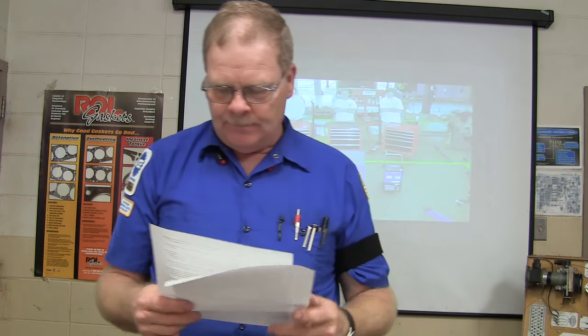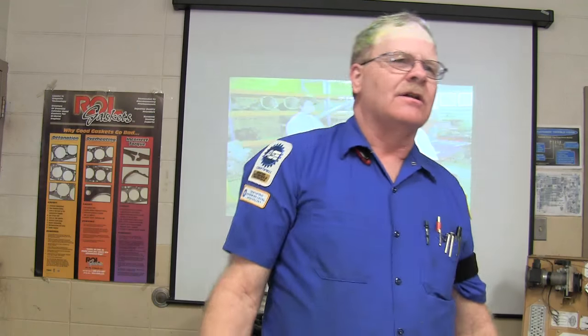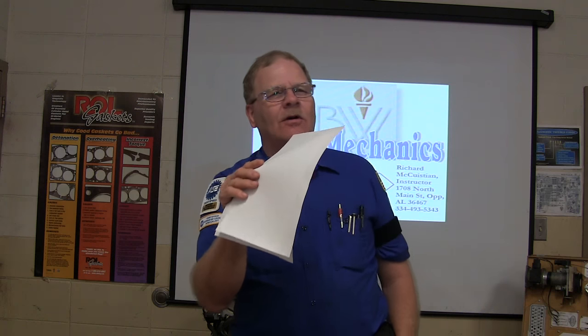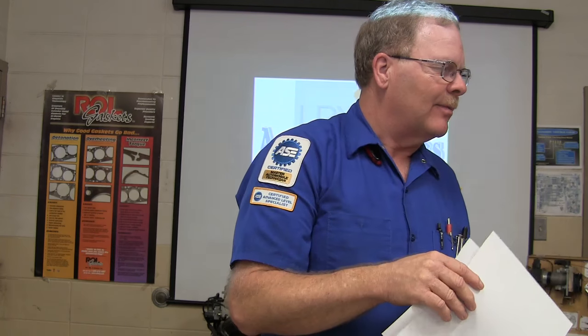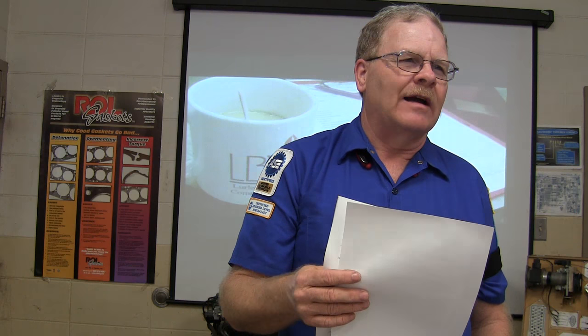The evaporator. The evaporator outlet. It doesn't say. You just have to figure it out. Think about what you're doing. What's going on in the evaporator? It's evaporating. It can't evaporate if it's already a low pressure gas, right? Yeah. So as it evaporates, what happens?